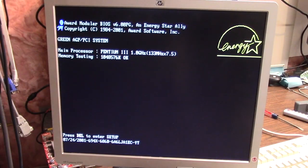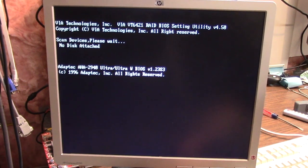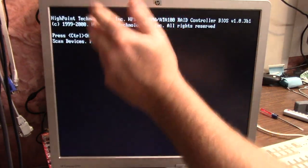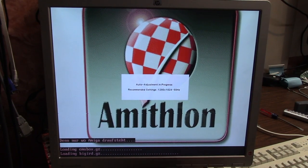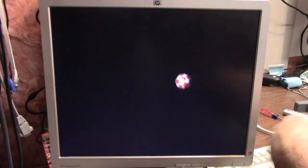So I'm going to boot with the Amithlon OS XL CD in the PC. I got a bunch of cards in this machine - it was just a junk build for an old system. I have an optical drive and a HighPoint card, old 2000s stuff. We're going to let this thing detect its drives and boot off the CD. This is loading the Big Bird kernel - it's a Linux-based kernel boot. If you see this you're going to be good. Now we need to use FreeDOS to configure this 80 gig hard drive and get it partitioned so I can install XL and have it boot natively without the CD.